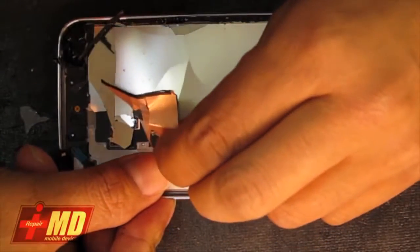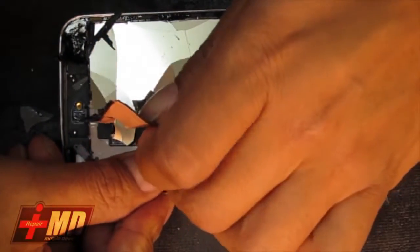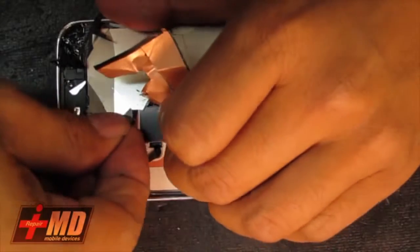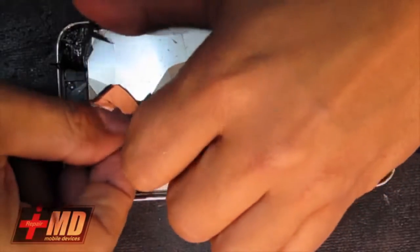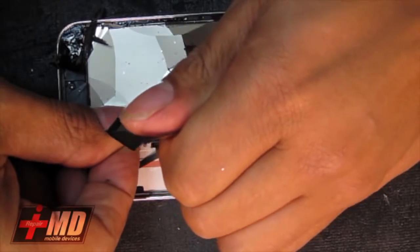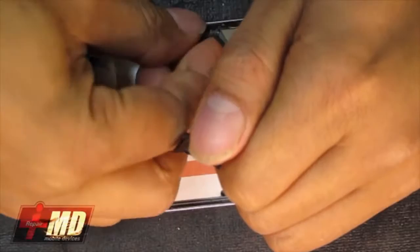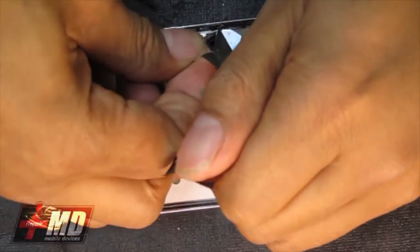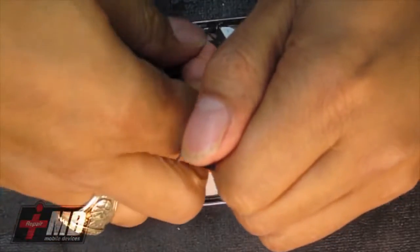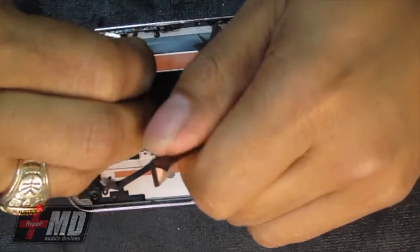All right, these are sensors. So pulling it carefully, examining any kind of flex cable that's possible to damage. I'm looking here now, there's no other flex cable on the bottom. So go ahead and pull up the base of this. This is the heat shield right here. Go ahead and lift it up carefully.